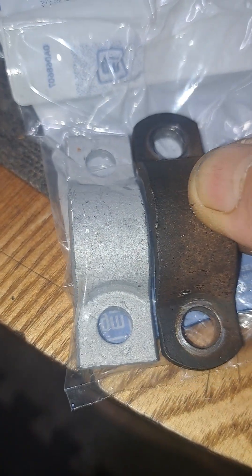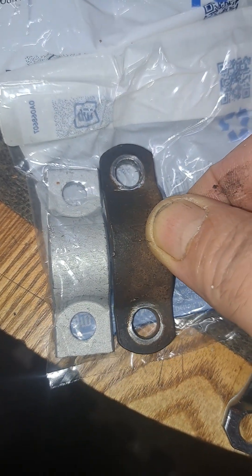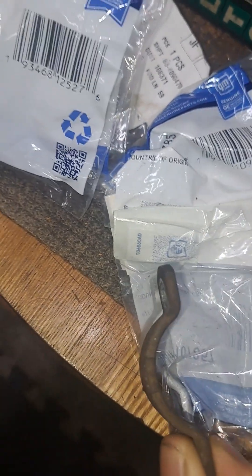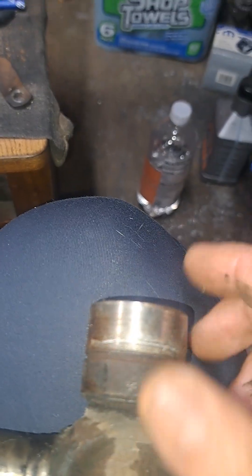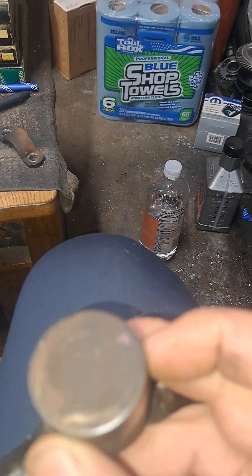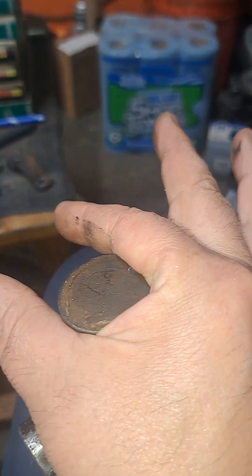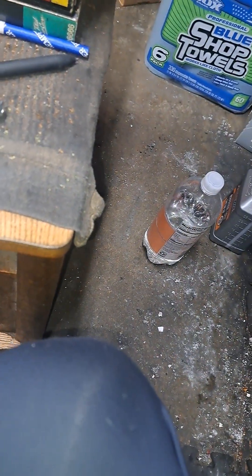Then you look at the size of it — the one that's in the truck is bigger. If I put it edge to edge, it's bigger. Then if you look at the throat, if I were to take this and put it on, it will not wrap around here — it would come here, wrap around, and it would not fit so I could bolt it and secure this to the rear end.